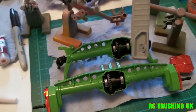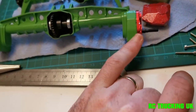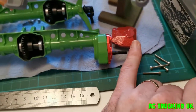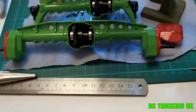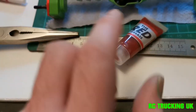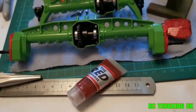So the axles have cured. Got some more bits here which have been primed. Going to go ahead now and fit the alloy portals to the ends and bolt them in with some stainless bolts which I've picked up, and also the brass diff cover which is now being sprayed. Bolt them up now — everything's all moving nice and freely. Just need to pop a bit of grease in the ends and the diffs and stuff like that. And that's the rear axle complete for now.